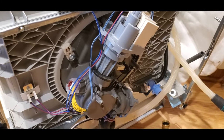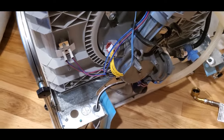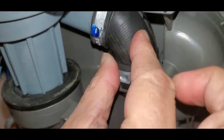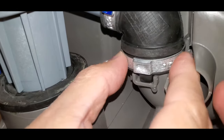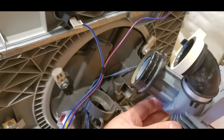What does a bad pump sound like? You can hear the click of the electrical contacts, as if the pump motor is trying to engage, but doesn't. It will run through all of the cycles fine with no errors, just doesn't circulate water. If your dishwasher does have a diagnostics feature, it will say that the wash motor wasn't working.